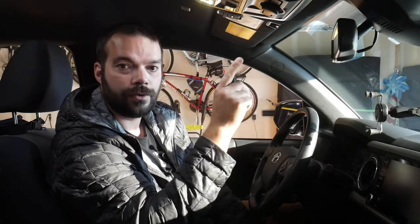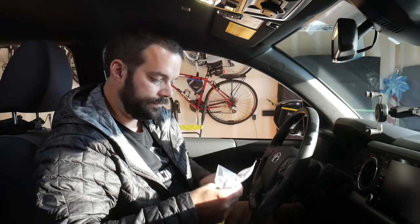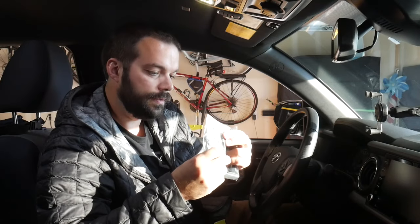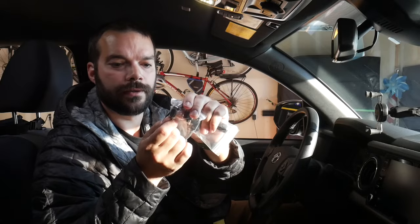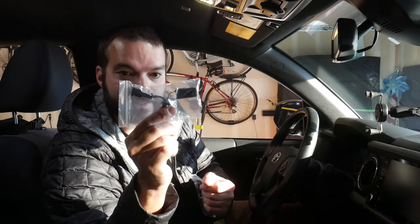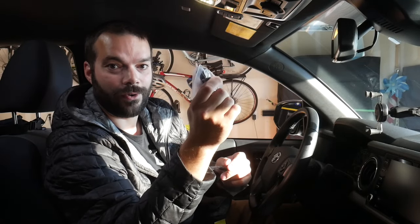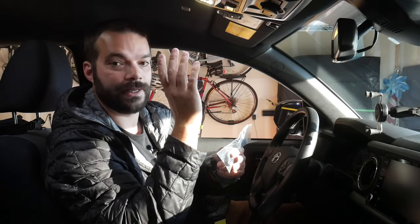What you can do with a car like this — most Subarus, most other Toyotas or Hondas — is if you have a powered rear view mirror with a certain type of pin connector on the back, you can use this dongle here with the much shorter cable. The dongle comes with a couple different types of adapters: a micro USB and one of the smaller older style USB connectors, like the Gen 1 micro USB. This basically takes power by disconnecting the mirror and plugging in here, then you have power to a USB while still being able to power your mirror. There are no cables running anywhere — you can take some zip ties and run to the back. Great for cable management.